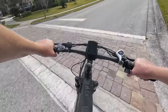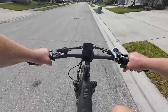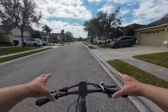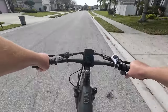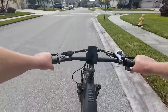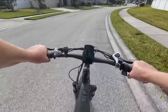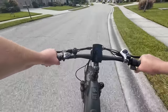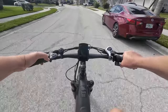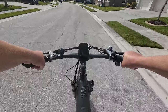It is a more aggressive stance, so if you like that kind of leaning forward stance, then that's perfect. If you prefer a more upright riding position like myself, it's a real easy fix — you can get a stem riser for about $10 which will raise the handlebars up for a more upright position. Now cruising around, we're just using the torque sensor in pedal assist one and we'll see how fast we can go. Right now we're at 10 miles an hour. I can put more effort into it but it's a pretty heavy push, and it really feels like a traditional bike at this point — it doesn't feel like I'm getting anything out of the motor. But that's because we're still in pedal assist one. Once I bump it up to pedal assist two, you can feel some relief there and feel that the motor is helping you out and giving you some push.